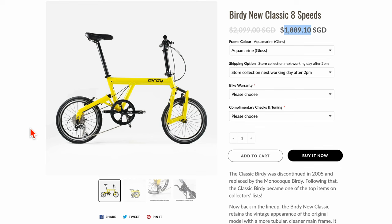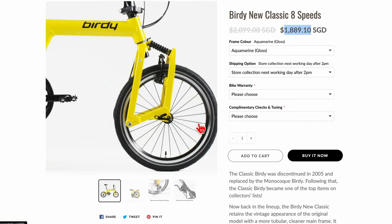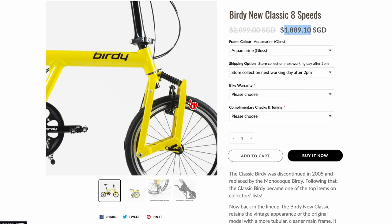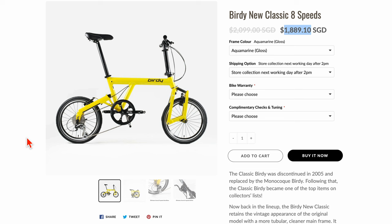The Birdie can take a hub motor in the center of the rear wheel. The problem is you cannot put it in the front, because the uniqueness of the suspension means the frame is pushing the wheel ahead — the wheel cannot pull the frame. If you try to pull with the front hub, this spring would probably just get ripped to pieces, because it was designed for pressure, not for pulling. There is a latch connecting it, since this is a folding mechanism, so you are not going to be able to put anything to the front.